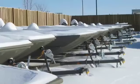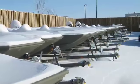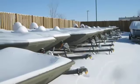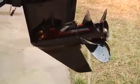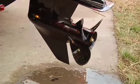During winter, avoid allowing accumulations of snow and ice on your boat or boat cover. Extreme heavy snow can actually cause physical damage to your decks or trailer, and ice freezing in the plumbing of your live well may expand and damage the parts. Freezing weather can also cause problems for engines stored outdoors. For outboards, store them upright so that all water drains from the cooling passages.